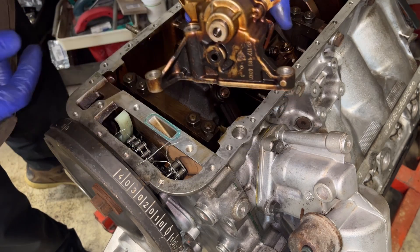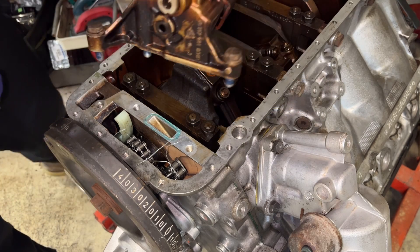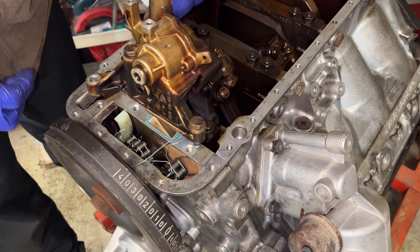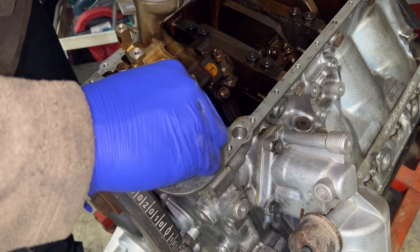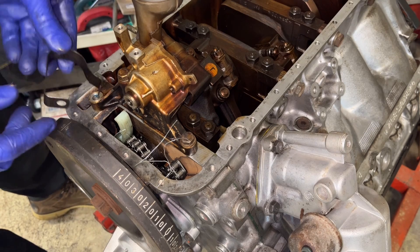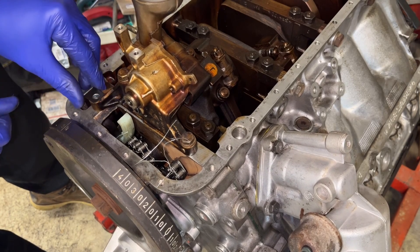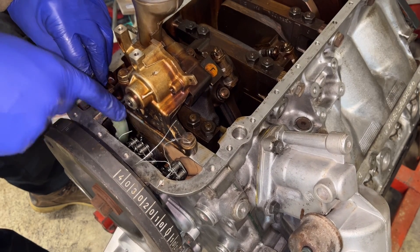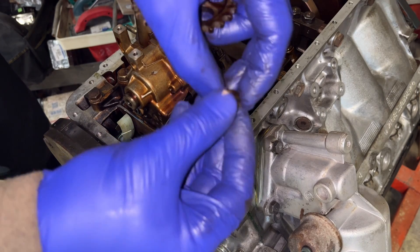This is where your gear goes on. There's a long bolt and two short ones. The clip goes in this orientation and you shove it under here like so. You can see how that keeps the tensioner guide nice and tight up against the chain. It has a little wave washer on it, which is a small spring washer.